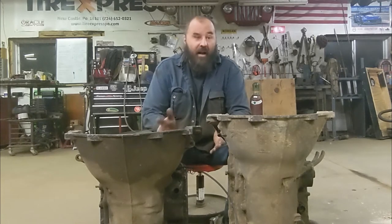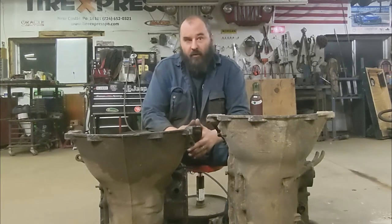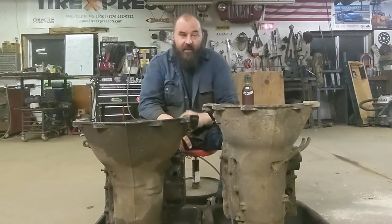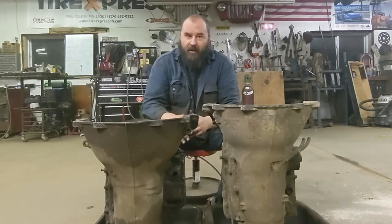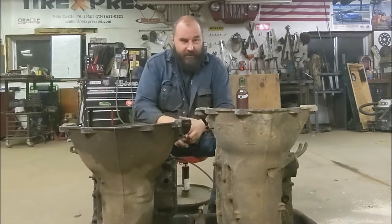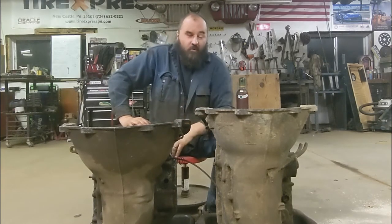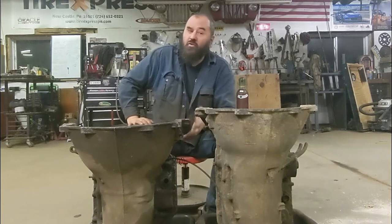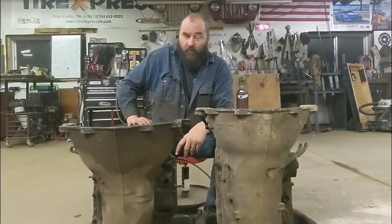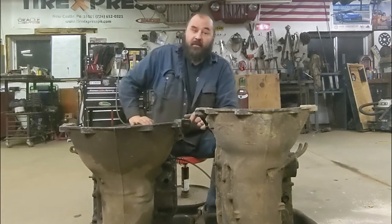The other reason is I don't need an overdrive. I don't drive my Jeep on the road very much, so overdrive really isn't important to me at all. A shorter drivetrain is way more important than having an overdrive transmission. The 4L60E has a 3.08 to 1 first gear ratio, whereas the Turbo 350 has a 2.50 to 1 first gear ratio. We'll get into some math in a minute and I'll show you why that's going to make a huge difference in the crawl ratio of my Jeep. Since I upgraded my 40-inch tires, I've definitely lost a bit in gearing, so this is a great way to get better gearing at the front of the math.